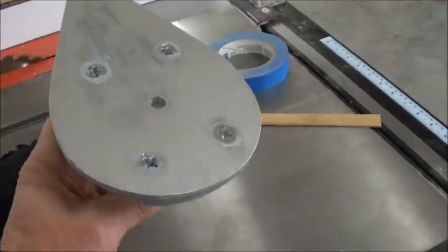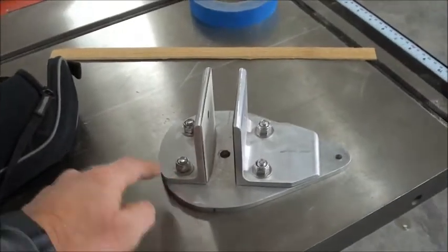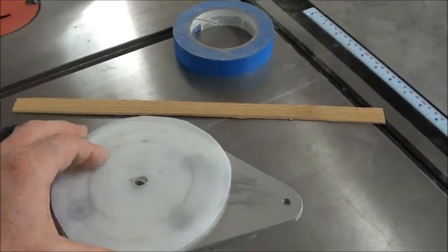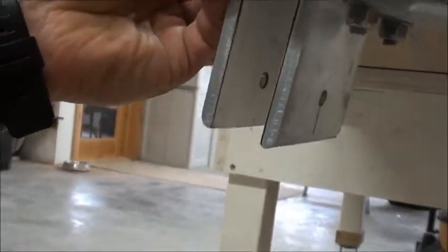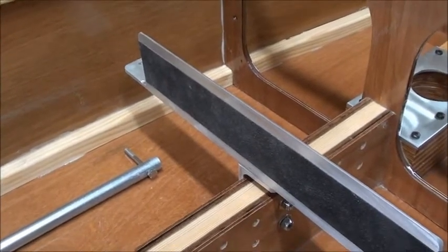On these I have some flat-head five-sixteenths bolts, lock-nutted on the back side. These are just three-inch by three-inch angle, cut and modified to work. On top of that we get a plastic bushing. You can cut that bolt down, then nut it — and that's your steering. Then you have the steering pedals hooked up to the steering chock.